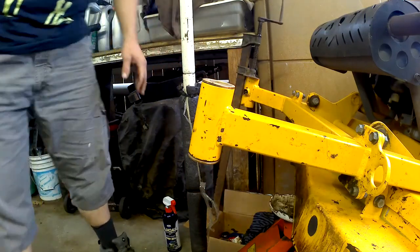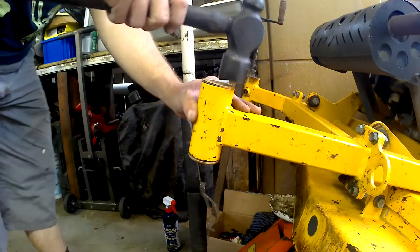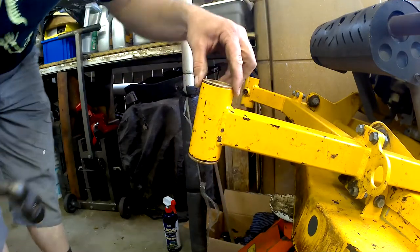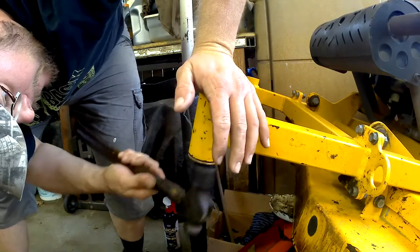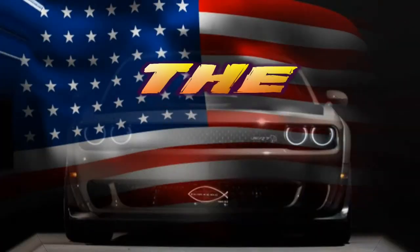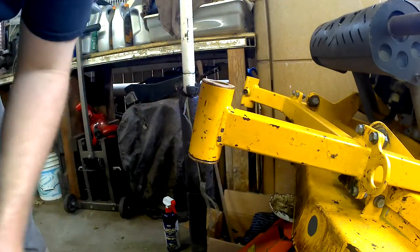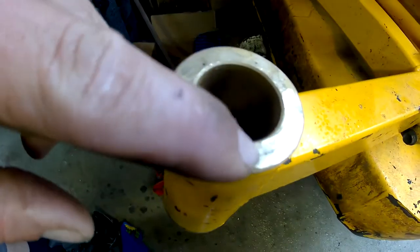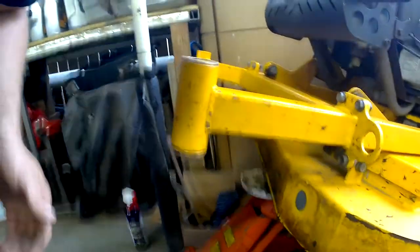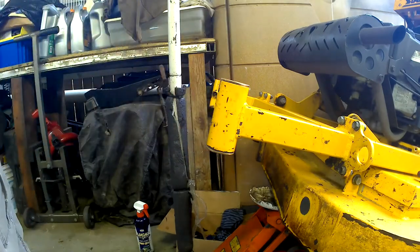Alright, get ready for the head on here. I'll just do one at a time on the other side. Okay, now we need to tap it. You really don't want to hammer too much because you can end up with these little fractures here — it's a soft metal, it's not designed to be beat on. So I would definitely recommend beat the old ones out, but don't beat the new ones in.